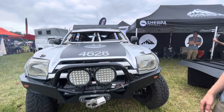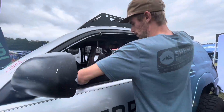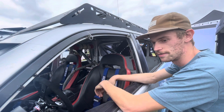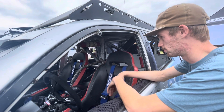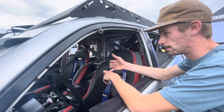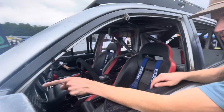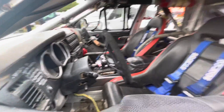Can we take a look around the inside and the cage? Absolutely. The cage and everything is home-built — we're definitely not great fabricators, but we've learned a lot doing this whole process. We built everything ourselves inside here. The cage is two-inch DOM and it's got a six-point cage, so you've got your A-pillars dropping down through the floor and into the frame, B-pillars through the floor to the frame, and a C-pillar.